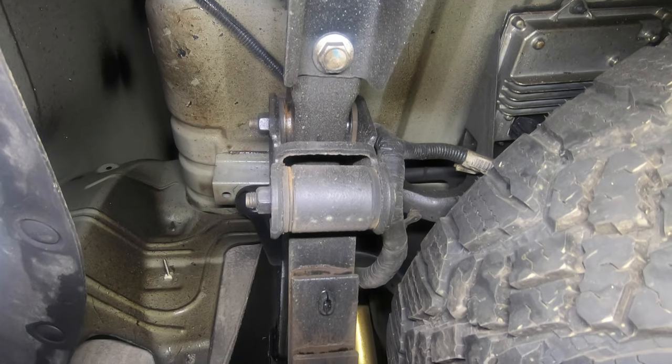I'm going to blow it all off with a pressure washer on both sides — from the cross member back to the spring mount — then one side gets coated with wool wax, the other side with fluid film. The other area I'm hitting is the front of the axle, which has kind of been the one spot where I can't get fluid film to adhere — it simply gets blown off by all the water spray. And for anyone saying it's not a true comparison test because I'm not doing the whole truck — if you want to blow 2,000 PSI at your wiring harnesses, feel free. I'm not creating problems I don't have.